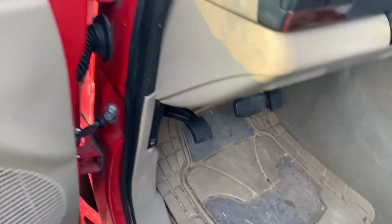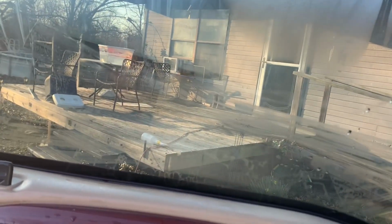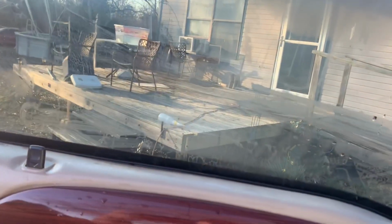Okay, guys, so what I did, I took my steamer here and that razor blade. I got this started up. Now, just continue down with it. Getting it started is the hardest part, unless it was like that layer there and it was already peeling. But with this steamer, it makes it pretty easy. So I'm gonna keep going, focus on what I'm doing, and the best thing I can tell y'all is to go slow and take your time.